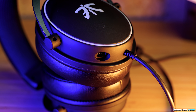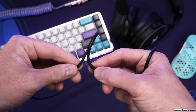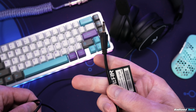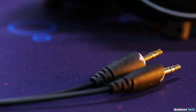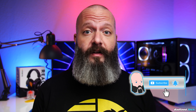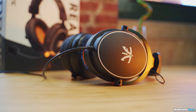Controls on the headset itself are minimal — basically a keyed section for the detachable mic and the attached cable. The cable is rubberized and flexible and on its own pretty short at three feet, which is intentional because this is not a USB headset. You can use this with literally any console, laptop, or phone that has a 3.5mm aux. On the cable you have analog inline controls for volume and mic mute. The other included cable is a much longer six-and-a-half-foot extension that splits into separate mic and headphone jacks for use with your motherboard or external gaming DAC. This headphone is rated at only 23 ohms, so you can drive it with almost literally anything. This is eSports-focused, so it's dead simple in terms of its design, use, accessories, and sound signature.